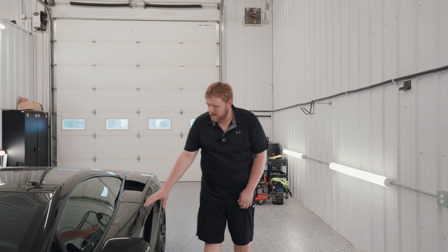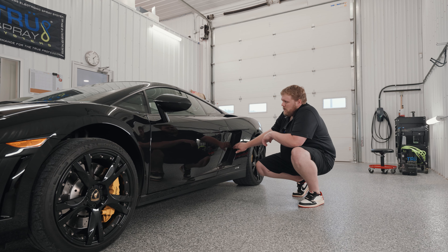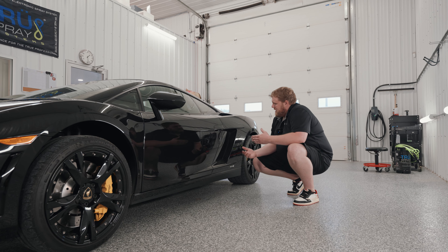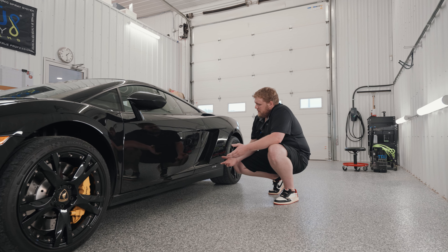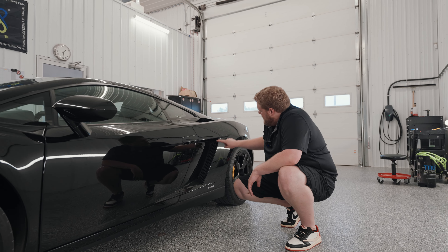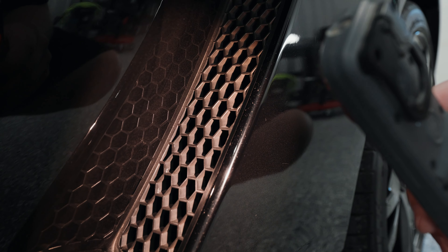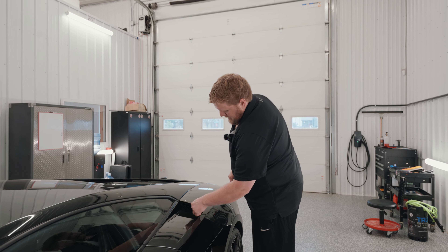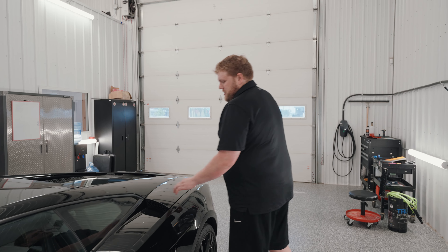When I look at this door, it's quite complex. This whole part of the vehicle reminds me of the C8 Corvette with the air dam in the back — I've wrapped a couple of those. This is my first Lamborghini; I've never wrapped one before and I'm super excited, but I'm thinking we're going to have some seams over here. These are pretty high tension areas — you don't want to do these in one piece because you run the risk of the film lifting up and looking really bad. Right over here we're going to have relief cuts just to get the film into place. This leading edge is quite pitted up with small rock chips — there's a lot of pitting that we'll have to fix. We have this piece back here with about a 3/8 inch front-facing edge which could get hit with stones quite easily — we're going to wrap that and make sure it's protected properly.